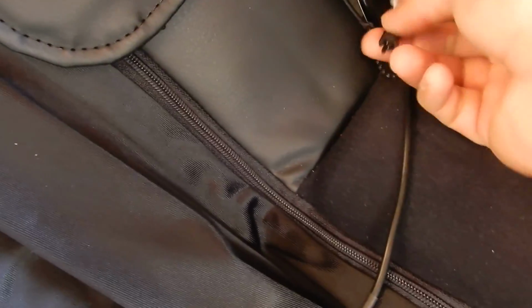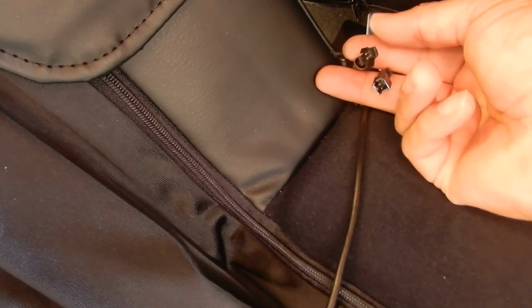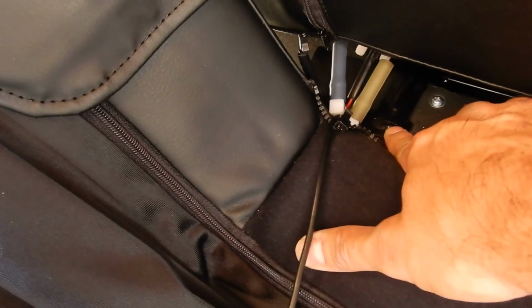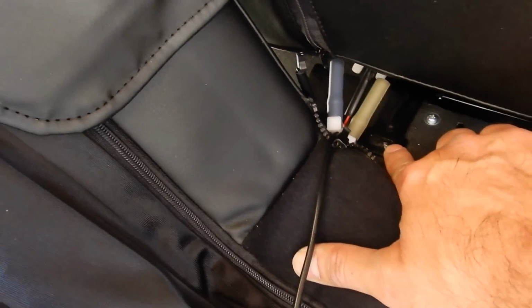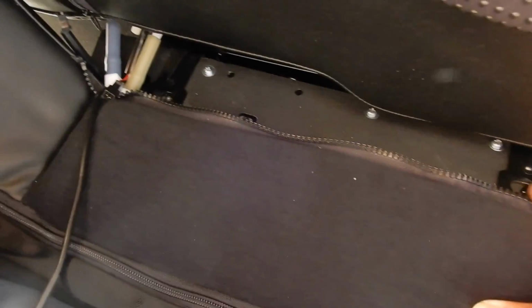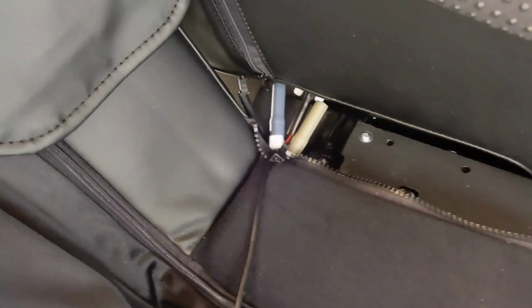So we've got, again, the two connections here, the two air hoses. They're going to plug in right there, and then the black connection, the cable, just plugs in together right there as well. Again, your spot here for your rear screw that you took off earlier, and then the one in the front. Again, very important, you do the rear one first.